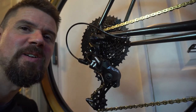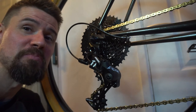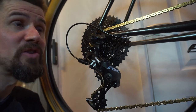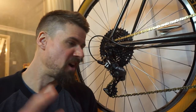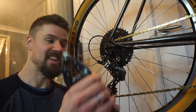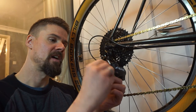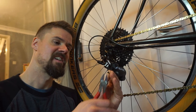The gears are now shifting pretty crisply for a 32-33 year old rear derailleur hanger — that was the main concern, as a bent hanger would have required extra work to fix. I can take it off the stand now and put the wheel back on ready to test it. To finish off, I'm taking the cable cutters and cutting the end of the cable, putting a little black end cap on, and crimping it into position — tidy job done. Thanks for watching another episode of Try Real Hard — please like and subscribe, and if you're enjoying this build series please vote for my build on the Spin.app website.